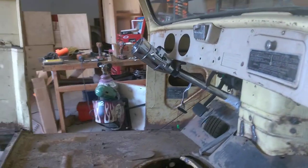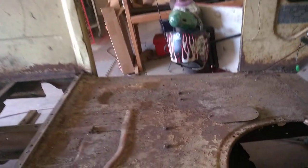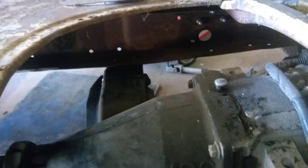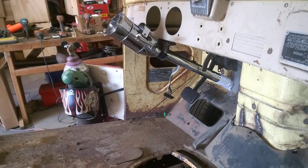We've used a lot of the Crown Vic parts, and I'd like to mention some of that. The transmission crossmember got cut out of the 2004 and Kyle refabricated it, bolted it to the underside of the frame. The steering column came from Amazon for about $190 — it's a GM type thing.